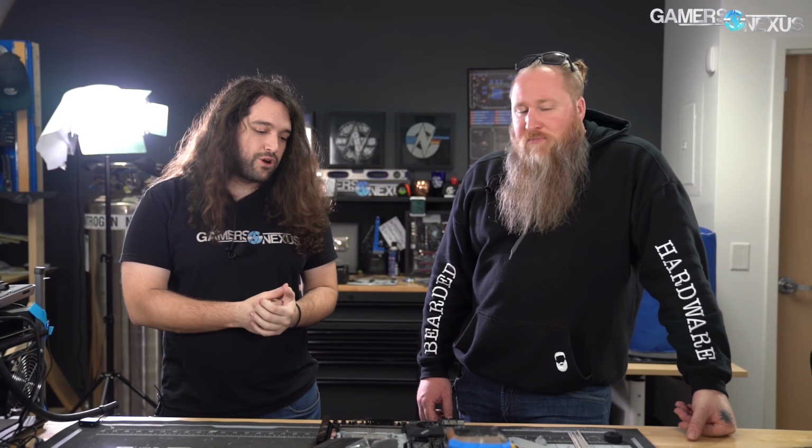The big takeaway here, first of all, is that this almost certainly voids your warranty, but you could do it at home and it would have actual potential benefit. This is the kind of thing you do if you're interested in competitive OC or you just want a fun project. But it is possible to lap something poorly and end up with a less even surface. It's kind of hard to do, but it's possible. So Joe will help provide some guidance on that, if you want to follow along at home with maybe a less expensive chip and improve your thermals.